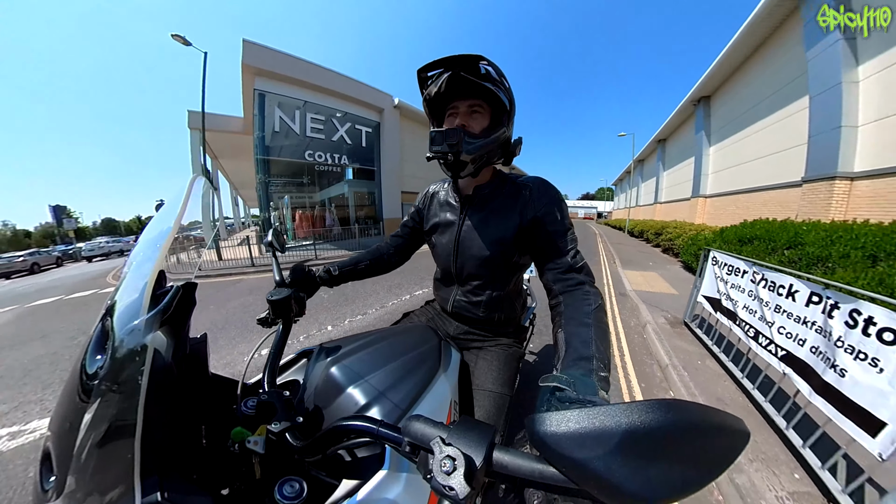RPMs of the motor are here. This shows you your regen. So as you get into regen, it will go blue and show you that power's going back to the battery. Then you've got your regen number, which can be 0, 1, 2, or 3. 0 is off, 3 is aggressive, 2 is good.